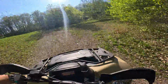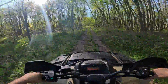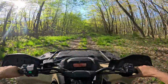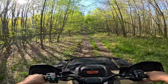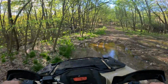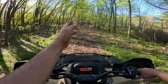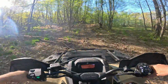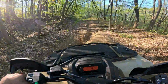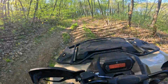The bumps in the trail very nice, corners amazingly. It has got a pretty hefty sway bar on the rear, rear sway bar on the rear, go figure. But that helps keep it nice and planted when you're cornering, shall we say, very spiritedly. Now the one downfall to that, as we get to my flex section here and you're flexing the machine out, is it does cause it then to lift the wheels pretty good as you get in off-camber situations.